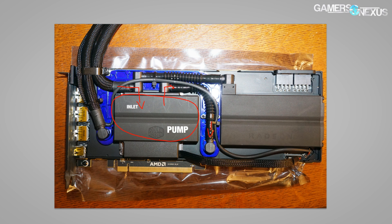There's an interesting twist to this. So let's label these inlet and outlet — liquid goes out, down this tube. This is a Cooler Master cooler, which you can see by looking at the tubing — it's their Teflon inner-coating tubing. The kind that if you bend it too far and kink it, it'll crack that Teflon coating and you get a lot of permeation.